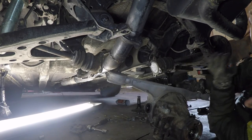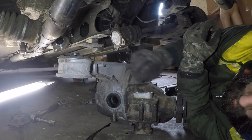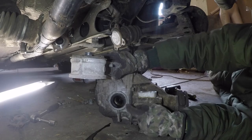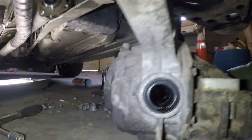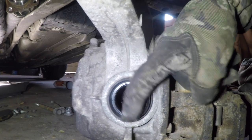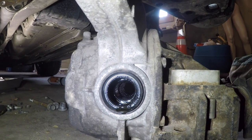It's out of the car. Now there's really no way to know if this is a Torsen or just a regular open diff without either opening the diff itself, or you can pull one of the CV axles and look at the inside. If you can see straight through to the other side, then it's a Torsen diff. If you look into the inside and there's a shaft going across the hole, then that is an open diff. Straight through with just teeth - then you have a Torsen rear differential.